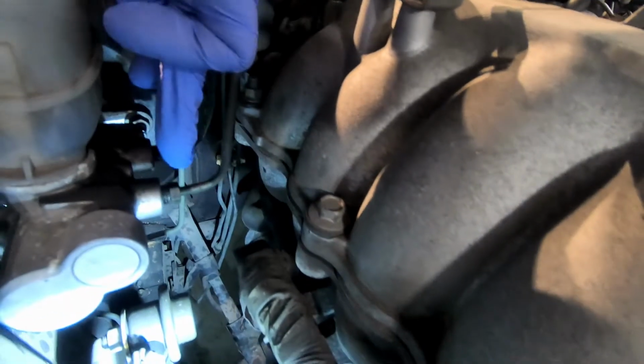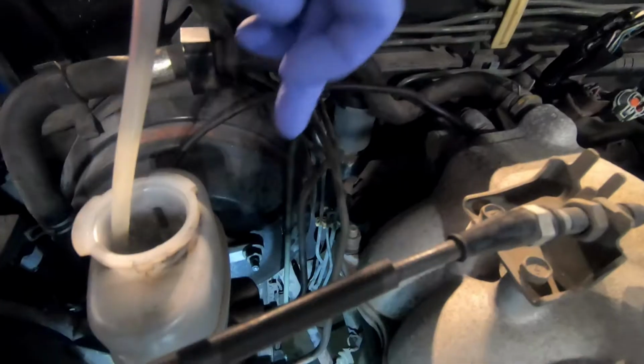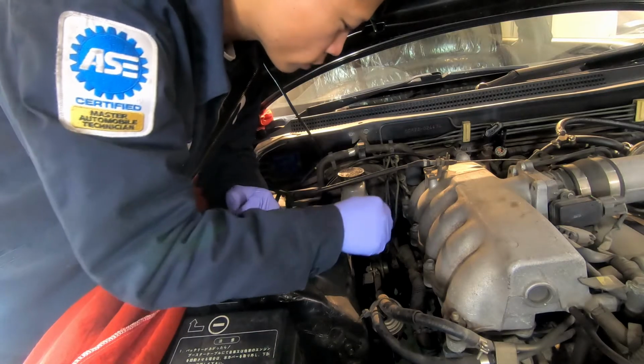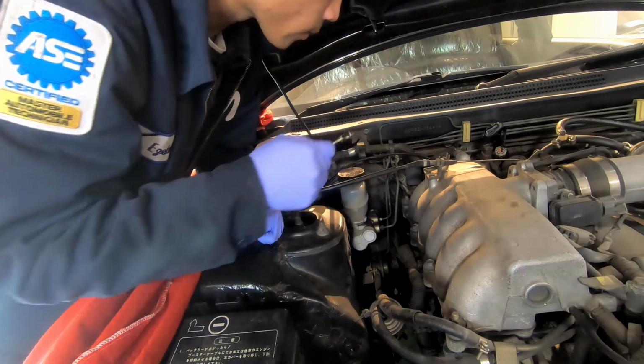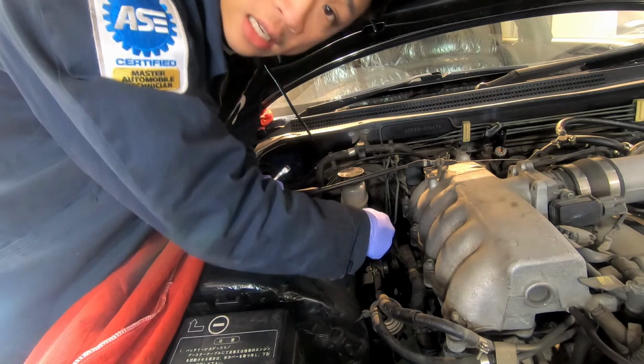so when I remove this, whatever residual doesn't spill out. I'm gonna crack open these two lines with my flare wrench, and then remove and then loosen the two bolts holding the brake master to the brake booster. I want to make sure to break these two hydraulic fittings loose first, so that I have a little bit of leverage. This guy is still secure.